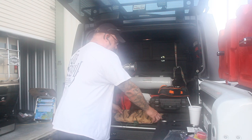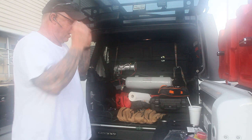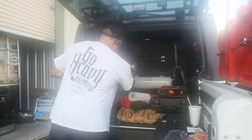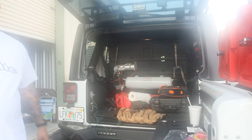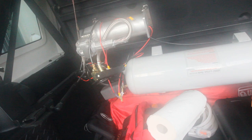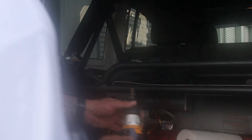I just want to say, I got my handy tool roll out. Anybody that's got any kind of truck or Jeep — this tool roll is probably the best thing I've ever bought. It holds a lot of tools, rolls up, tucks away, and doesn't rattle. I unmounted it, swung up the shelf, and got my 12 volt tester out to see which one of those wires is hot. The bottom wire is hot, so that's the wire we need to be careful with. I have a disconnect right here, so I'm going to disconnect that and come up closer to show you guys what it looks like.